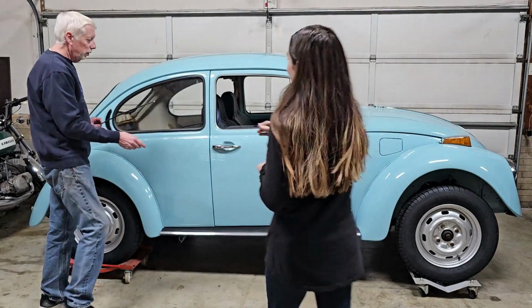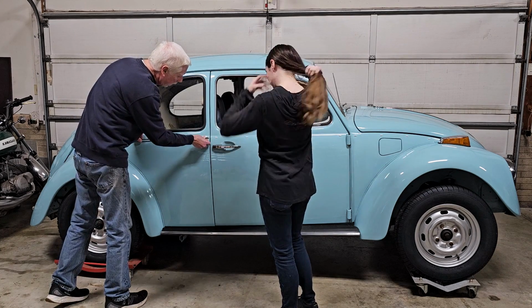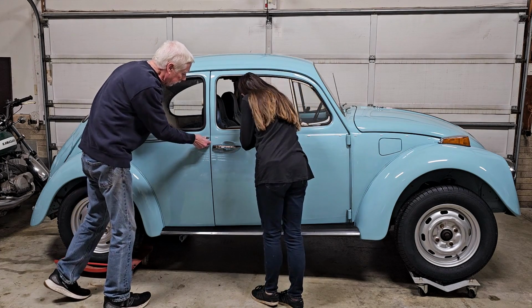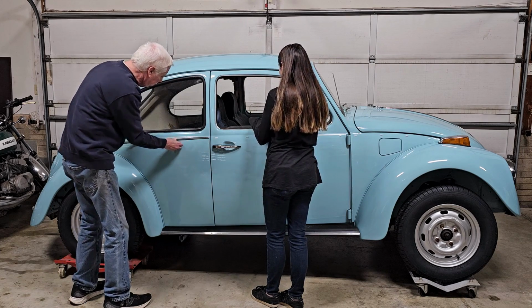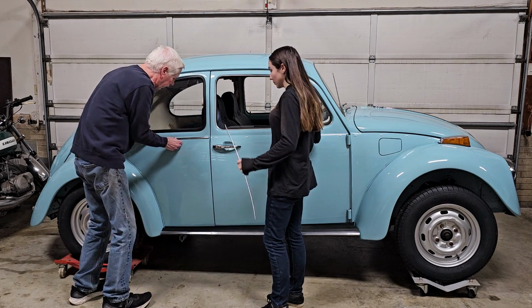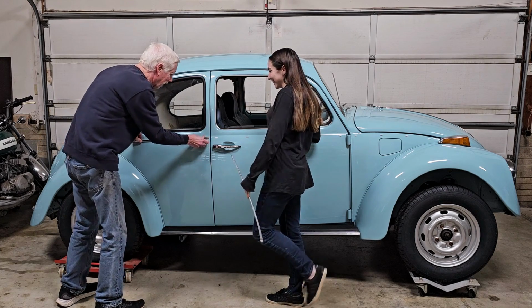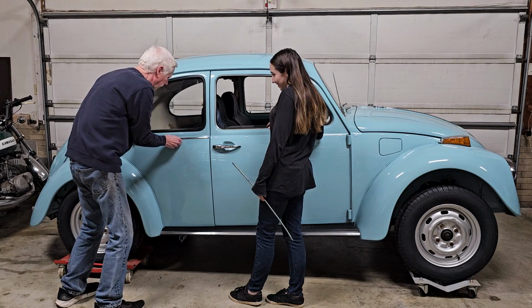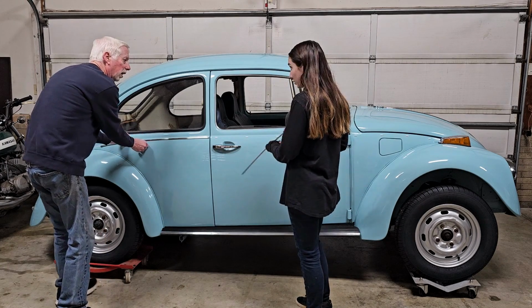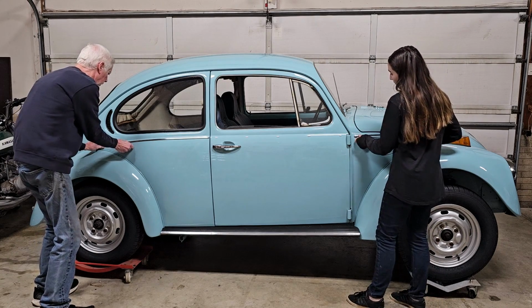Now, once you've got the clips in place, simply line the molding up. In this case, I want it to go up next to the door opening, and you can put it in place, and the molding will simply slide over the clip and pop into place. Very simple. There we go. So this side goes on the front, because it's rounded, the radius one? Yes. Which direction? The flat piece goes back towards the door. Okay, that makes sense.